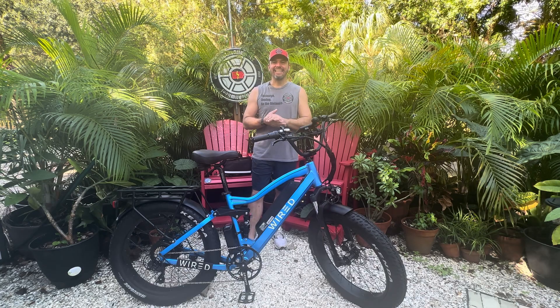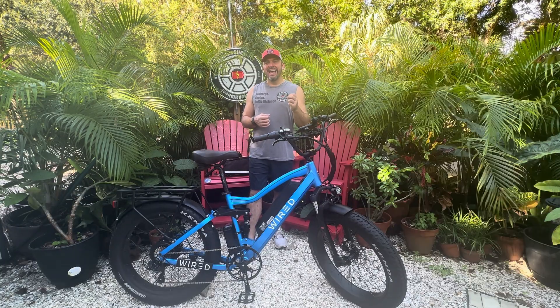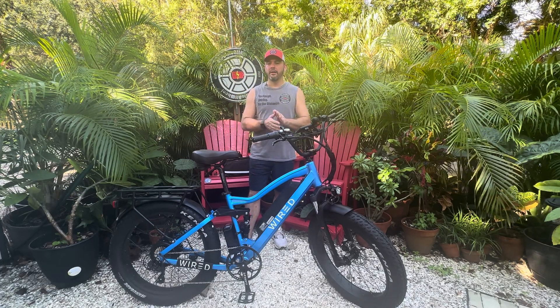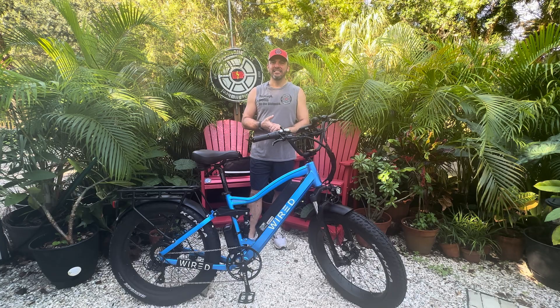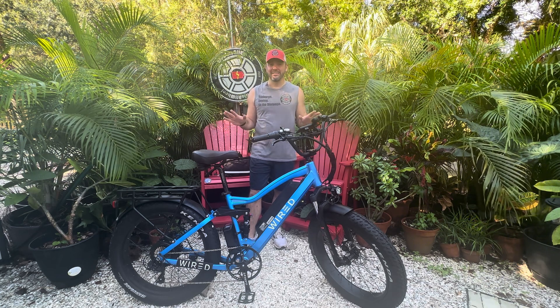We will be adding a Daydex DX2 with our 12 AWG wiring. We will adapt from the XT90s to XT60s and then into a bag here on the rack, get the DX2 in there, and then make the battery connection in the Big Daddy Rack Bag from Bike Case. We will be leaving links to all the products in the description below. We are pretty excited about this. This bike is unbelievable.